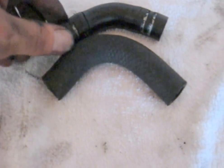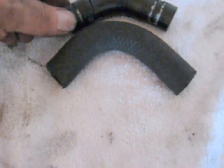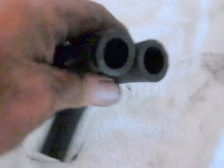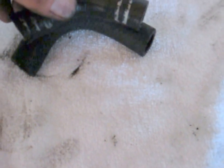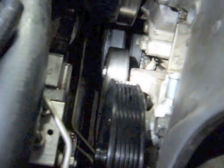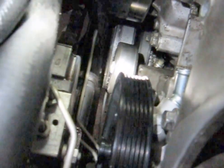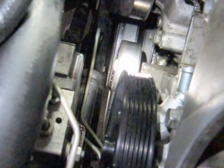This is the hose that the mechanic I mentioned in my other removal video was nice enough to give me. Looks like it's right on there for the ID — inside diameter. I'm just going to mark it and trim it down to the correct size. If you took that tensioner off as I did, put it back on before you put the reservoir on.